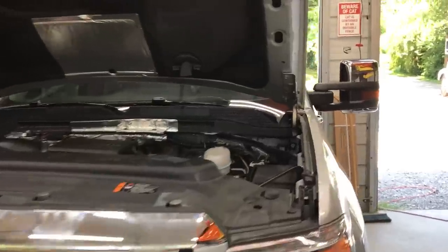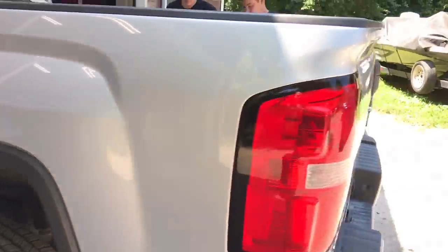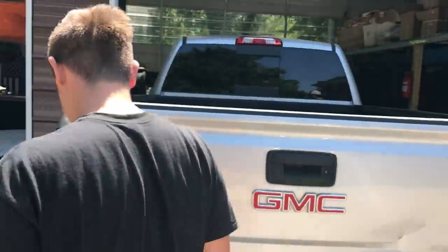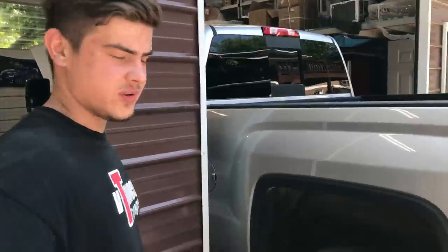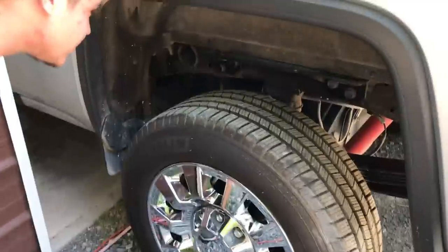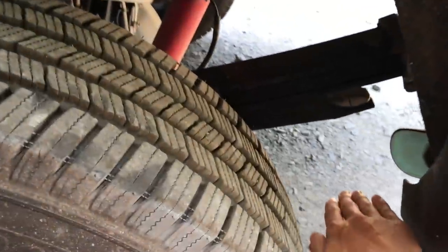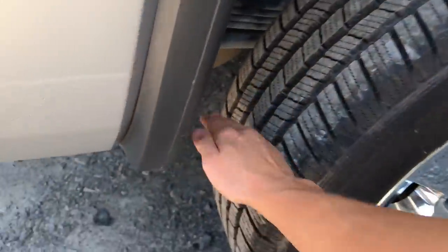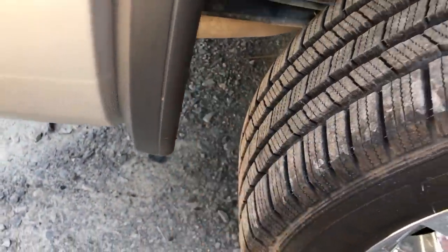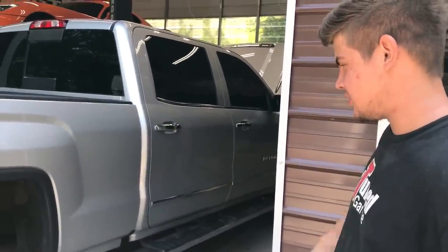Before we start taking anything else apart, V-Tuned actually noticed something about the rear end. The rear axle is probably a little bit turned somehow. This side is sitting a little farther forward. It looks like when it got hit in the front, all the impact went to that side and just pushed everything forward. So this axle is sitting up. You could measure it with your hand — my hand fits here, but on the other end it's a hand and a couple extra fingers. So the energy kind of just transfers — a lot of weight, especially that big differential, just shifts everything, definitely with a big impact.